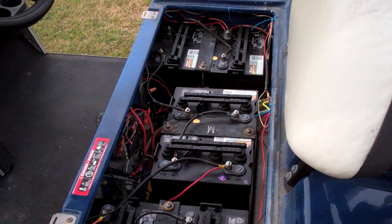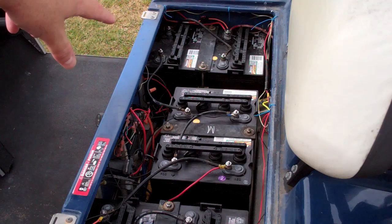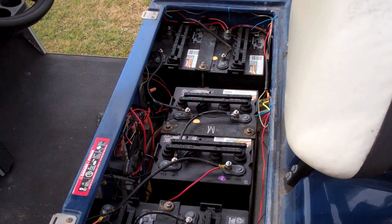When buying an electric golf cart, keep in mind the batteries are very expensive — plan on spending at least $600, upwards of a little over $1,000 to replace all of them. A lot of batteries will have a date stamp on them. You want to see if they're all pretty close in date. If you have a lot of different years, that may be a sign they've been replacing one battery at a time, which means you'll likely be replacing them one here and there.